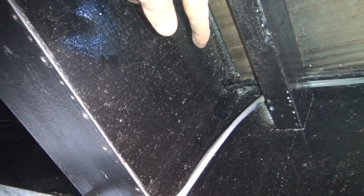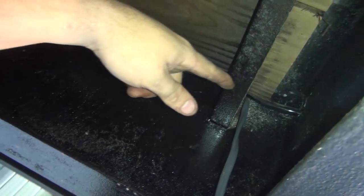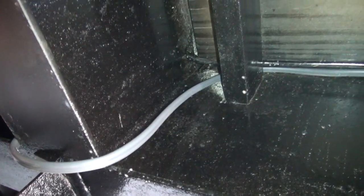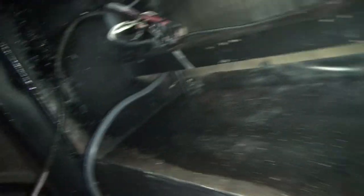You can see how the factory wire is done — how they put the insulation back and everything. I just followed this factory wire down until I got to right here. The factory wire goes through this cross member, but the hole isn't big enough for the 10 gauge wire to fit through, so I just looped it down and came back up on the other side. I didn't feel like drilling holes through three of those cross members while laying on my back under here.